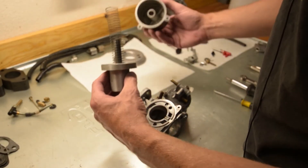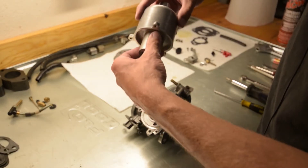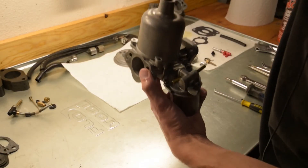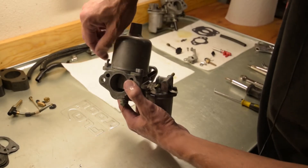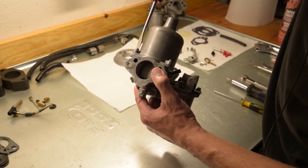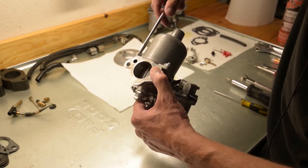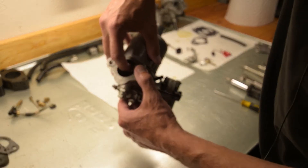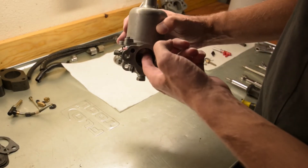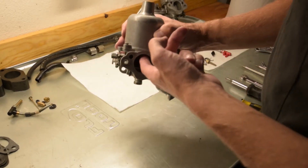Place our spring and place into the dashpot, carefully spin it around, line up our needle, line up our dashpot, and insert our bolts that do not have the washers. When tightening them, don't tighten them all the way down — just until they touch — until you get all three screws in, then give them a little tighten and check for movement. We did not take the lock nut out; if you did, you'd need to center the jet, but in this case the jet has a spring so it kind of self-centers.